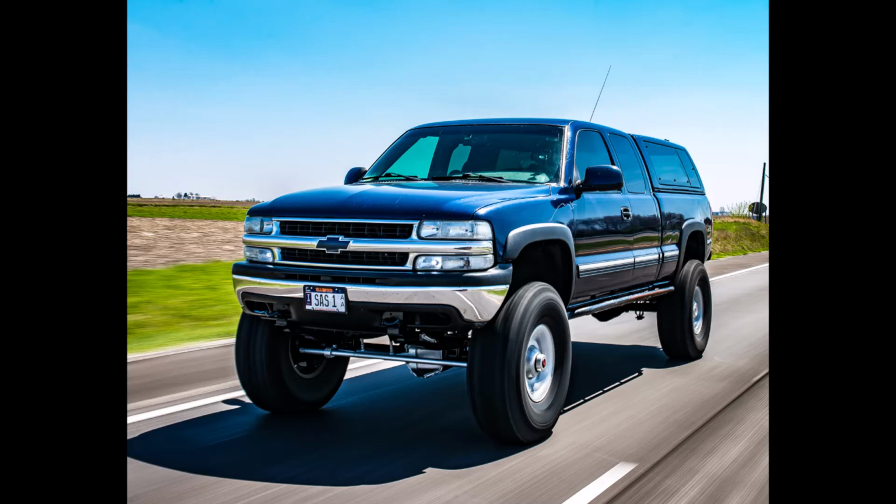It's pretty much like a yin and yang thing, right? Yeah. It's got pressure in it, so if the oil pump stops creating pressure, it keeps that pressure and feeds oil back into the engine. But then the upside is that your level goes up in your pan, so it never should run out unless you're completely upside down.